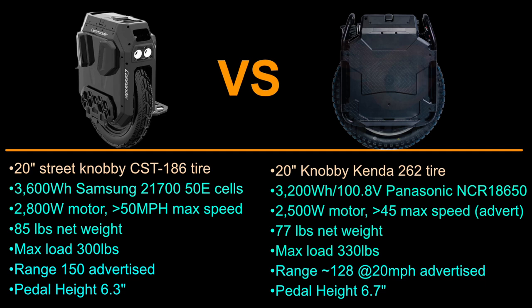The Commander's torque version is obviously more focused around torque, but it appears the high-speed version might have more torque than the Sherman. One point for the Commander there. The max speed is advertised at 50 miles per hour — and knowing how Gotway works, there might be a small buffer. The Sherman comes in one variant with a 2500-watt motor at an estimated 45 mph max, so 50 mph advertised for the Commander leaves a lot of room. I like that.